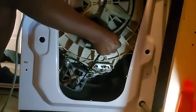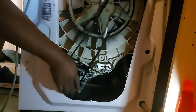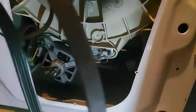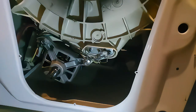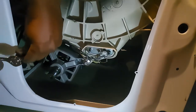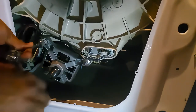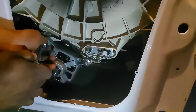Once you're able to remove the belt, keep it aside. Then if you look down where the main carbon brush motor is, you need to take out two screws on that side. It's held by two long screws — you need to take those two screws out.